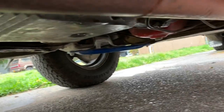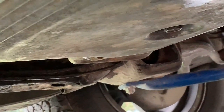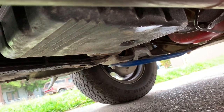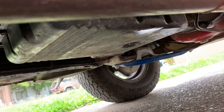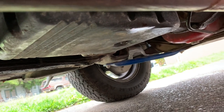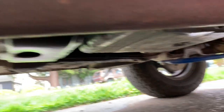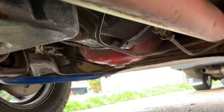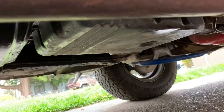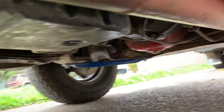One more thing I'd like to do with this car — another thing we broke at King of Hammers was the dipstick tube on the other side of this transmission pan. As you can see, it's kind of exposed there. I hit a rock with it and it completely ripped it out. On that last lap when I took the jump, I completely buggered it and it lost all the fluid. I did replace the pan, but I'd like to get a skid plate that actually goes all the way back here, because this stuff's pretty exposed. The oil pan I think is steel, but this thing's pretty exposed and doesn't quite take a hit like the oil pan does. So I'd like to have a bigger skid plate.